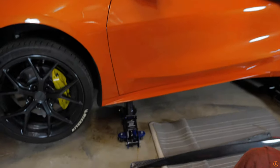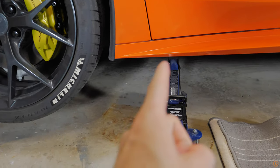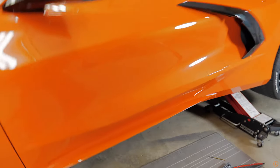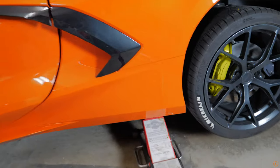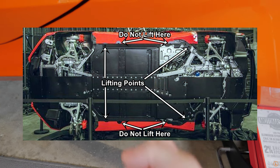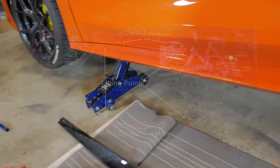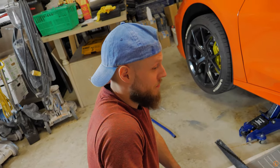We have the car jacked up and just to show you guys quickly where the correct jack points are — you can tell by how far away it is from the wheel wells, and then look at the back one as well, it's very very close. I've seen some people using the points here which are actually tie downs for dynoing the car — make sure you don't mistake that, because that'd be a disaster. It would be a big massacre.